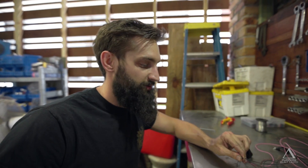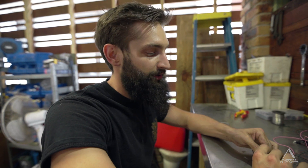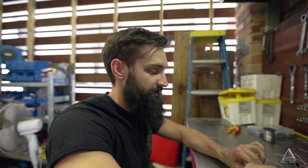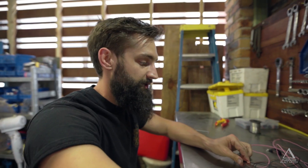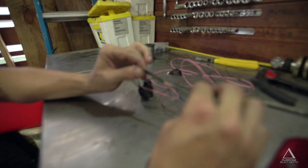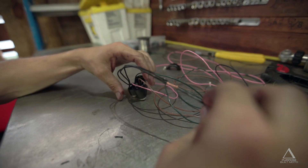These three push buttons are all switched to ground. I'm going to join the ground cable so I only have one common running through the handlebar — it just saves cabling and mess in the handlebars. So I've stripped that back and twisted it up together, and now I'll solder it and get it heat shrunk.